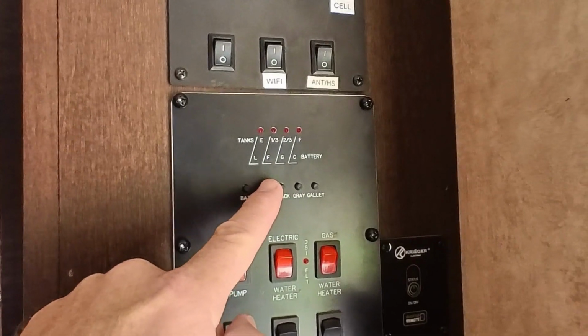I would add a gallon of water, go press the sensor button. When I reached the 4-gallon mark, that's when the 1/3 sensor kicked in. And while 4 gallons isn't quite 1/3 of my tank, it's a lot better than it was. So I got to 13 gallons and my 2/3 sensor kicked in, and that's a good thing. That's way better than it was before. Before it kicked in at 5 gallons, and that wasn't even close.